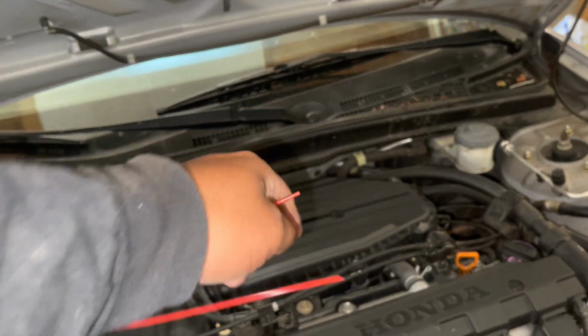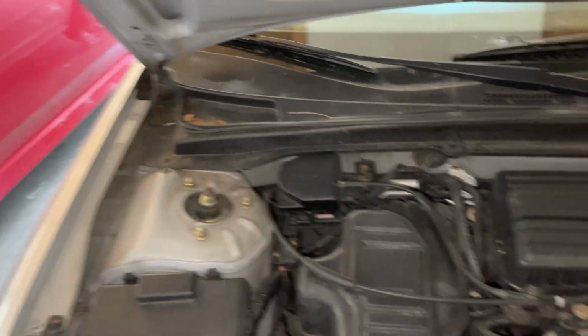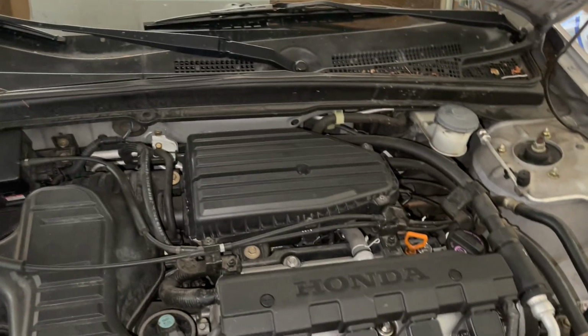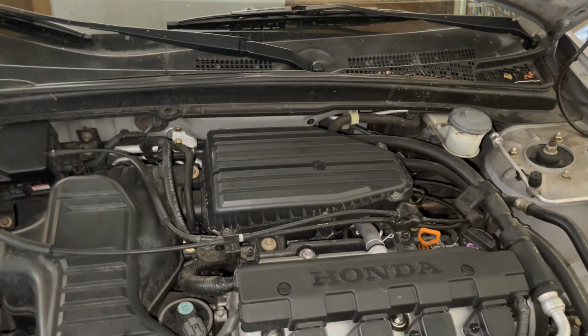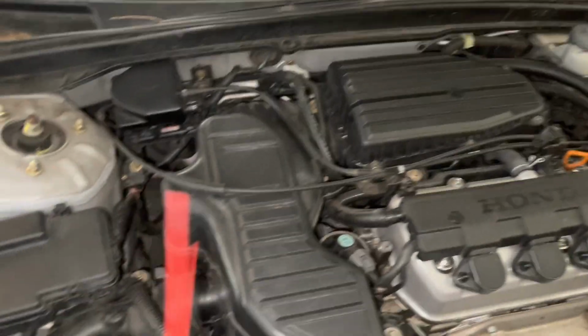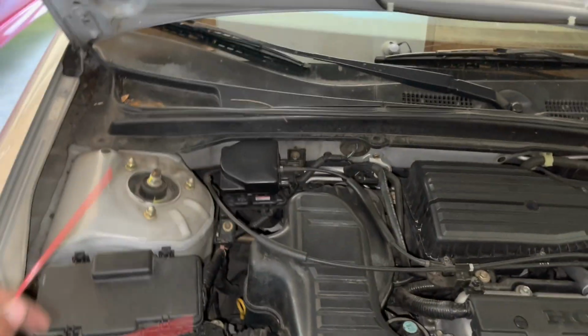But I'm gonna clean out the engine because it's been having a rough idle. Check the new filter, new everything. So this will clean out any sort of gunk. My wife had this car for a while, since 50,000. It's at 90,000 and the oil changes haven't been consistent. So I bet that it's clogged. So we're gonna go ahead and hook this up really fast and then I'll get back to you.